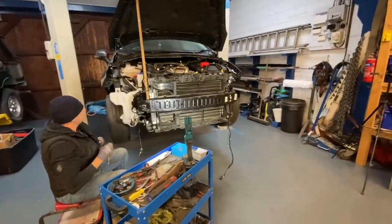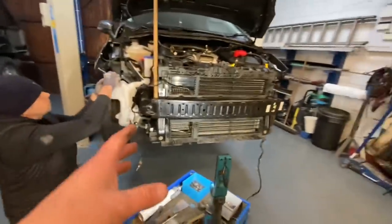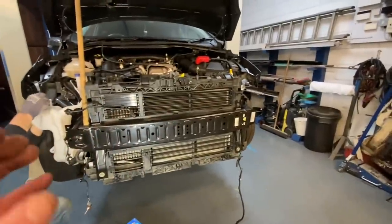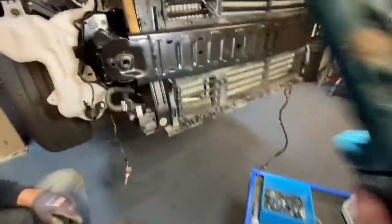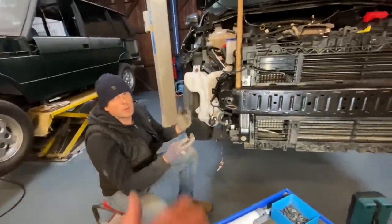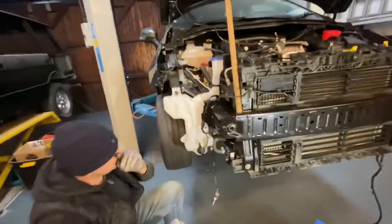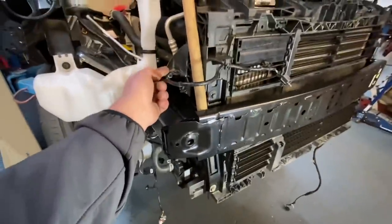Chris is moving along nicely — he's got the rad pack back in. They didn't bother time-lapsing that because you were all tired of seeing it taken off and put back on. Everything's all nice and secure, it all fitted very well, fell into place. He marked everything up with a red pen so that when he put the front panel back on — since I wasn't here — it would speed the job up. He hasn't had to realign it, it's back bang on its marks. The washer bottle he struggled to get out before because that chassis leg was bent, but it just plopped straight in fine this time.